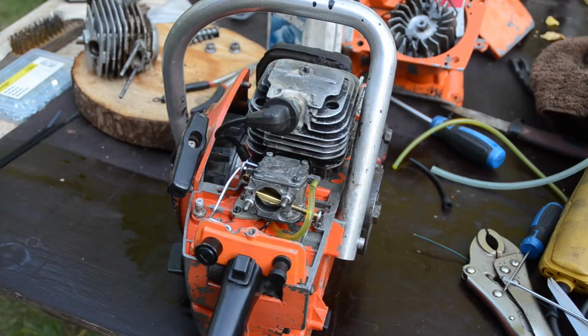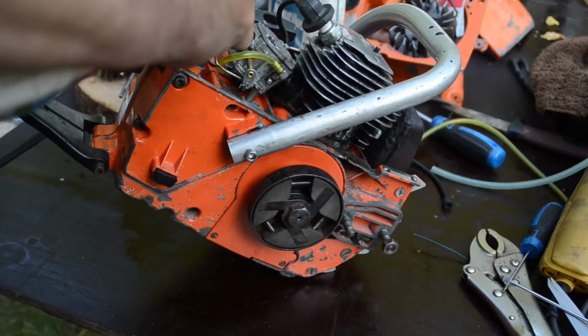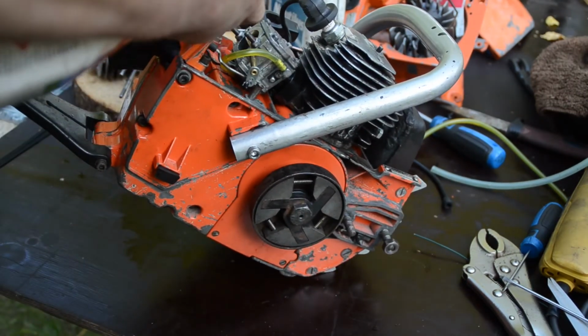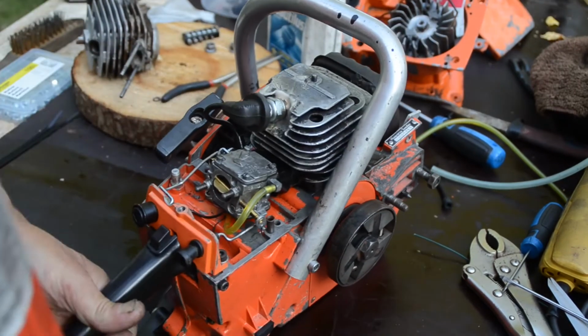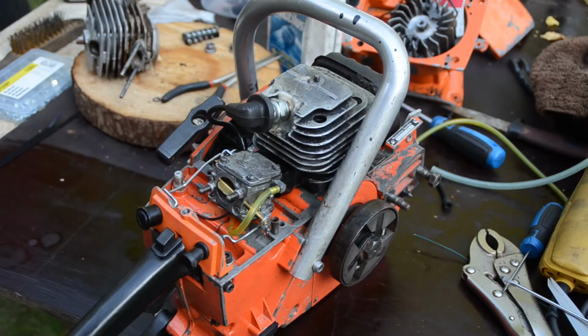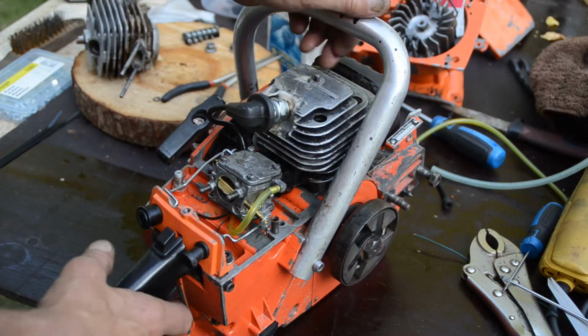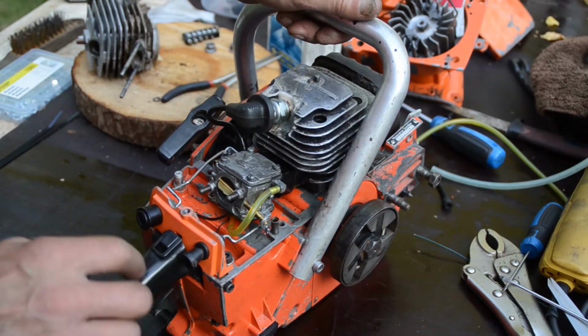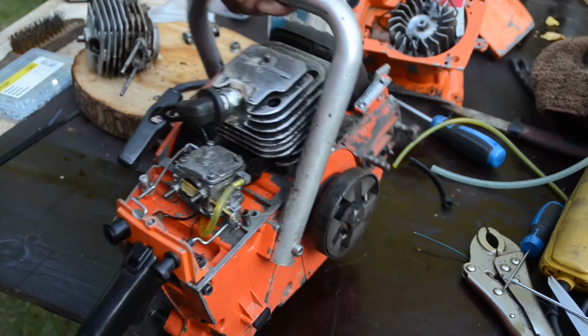And what I wanted to explain is that to help get the air bubbles out, it could be okay to give it a little drink. Just a few drops, depends on which saw it is, how easy it is to drown. It could be a little individual. So you almost need to have an intimate feeling about the special saw you're working with. I give it a little throttle, pre-speed, no choke, because it's 26 degrees outside.